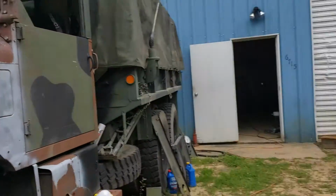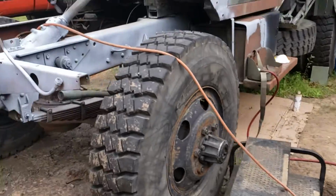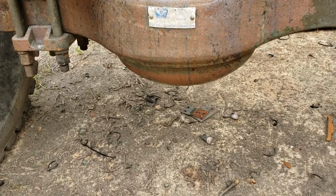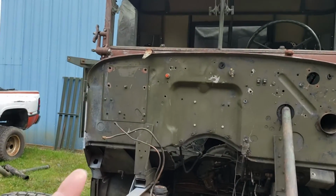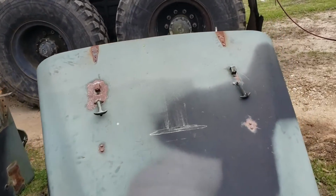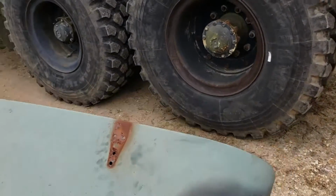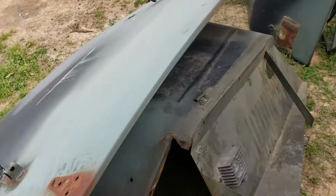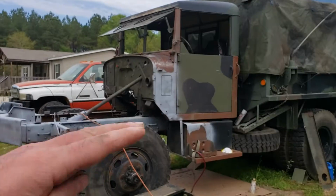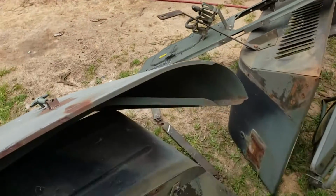So yeah, that's about it. I mean, make sure that you have... Okay, I dropped them down there. You see those reinforcement plates? Those go underneath the hinges on the inside of the cowl, and the same thing on the hood. They go underneath. You can make some copies of those plates for reinforcement and put them on top, like between the hinge and the cowl up there, to keep them from beating the cowl down later.